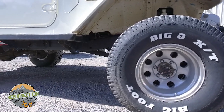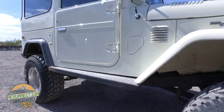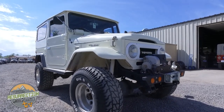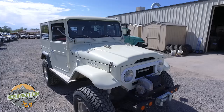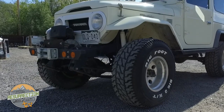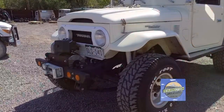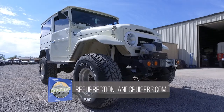What I would do to it if it were mine: replace the wheels and tires with OEM wheels and a 33x10.50, get rid of the aftermarket bucket seats and go back with FJ40 seats, and add factory front bumper and rear bumperettes to complete the OEM look. The paint's held up pretty well — just the top clear coat is peeling on the top, which could be corrected easily. It's a solid 3FE, H42 drivetrain with dual transfer case and ARB lockers, plus a Warn 8274 winch in front. Get one of our replica front winch bars to make the whole thing look more stock. Check it out on the website.